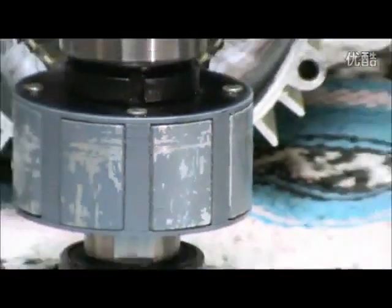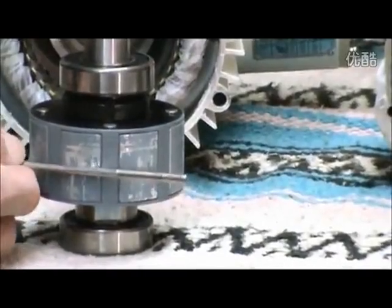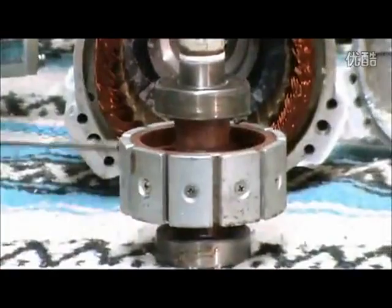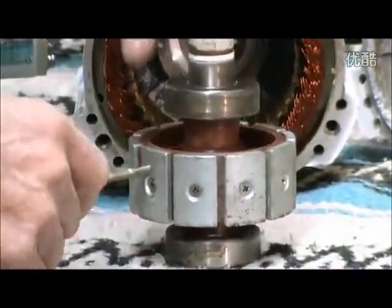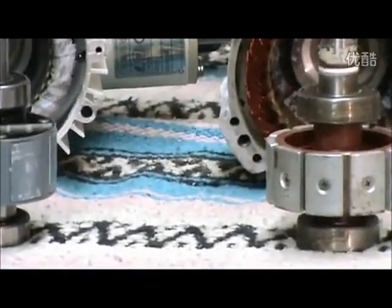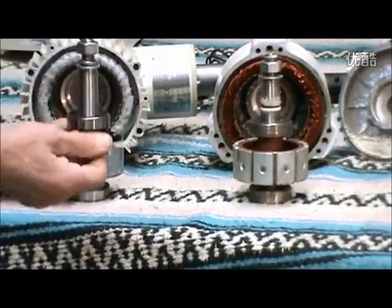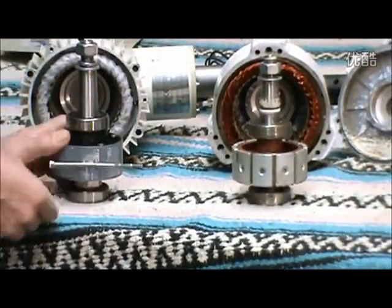Here are the SkyMax screws — they're all stainless. Here are the Gudcraft screws, the ones that come out of the Gudcraft. A couple of them actually broke off — they corroded in. These are dissimilar metals. You can't put steel into an aluminum case; it'll just corrode in. And that's what's happened.